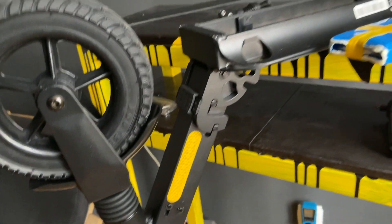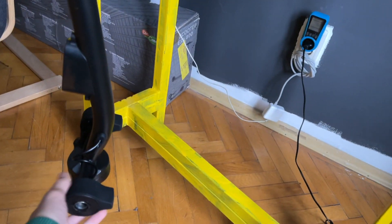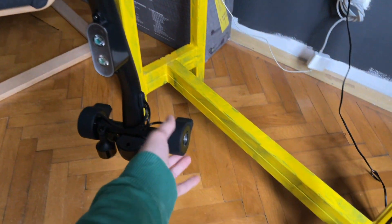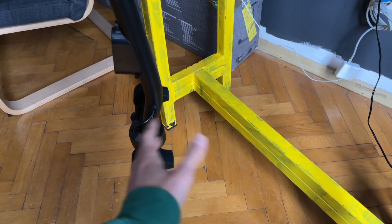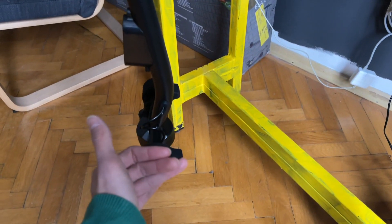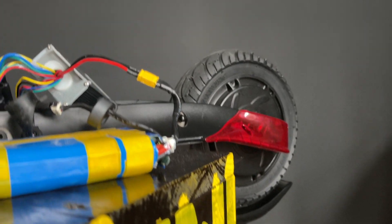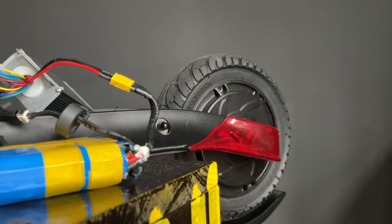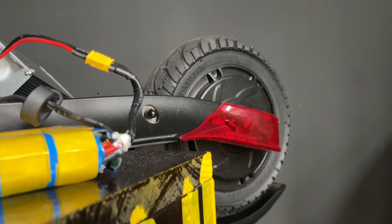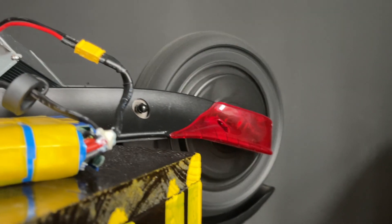This is the scooter — I've repacked the battery as best I could. It's a pretty poor product overall. It does have a PID controller regulating the revs. One thing I like is that it accelerates from a standstill, unlike Xiaomi which requires you to be moving at five kilometers per hour before the motor engages — which is complete nonsense. The PID control loop is actually unstable and oscillates. At full speed it's mostly fine — you can hear some periodic content but not a lot.